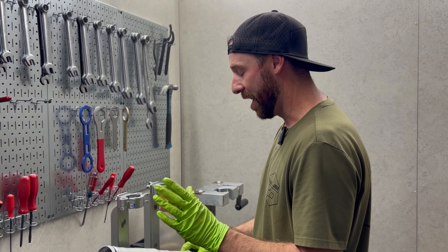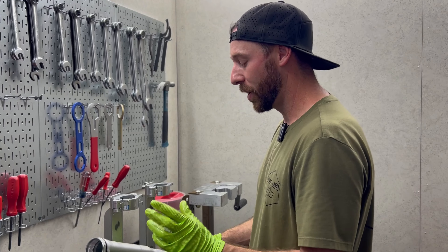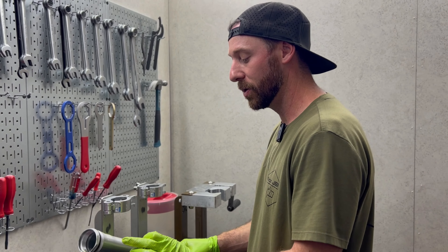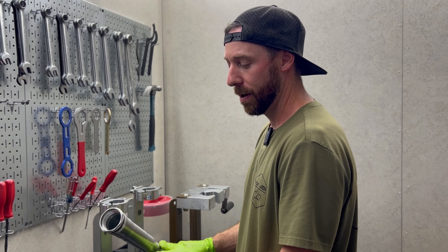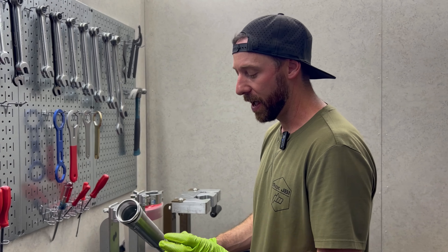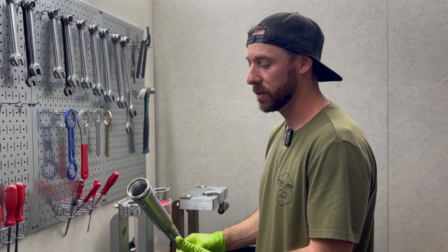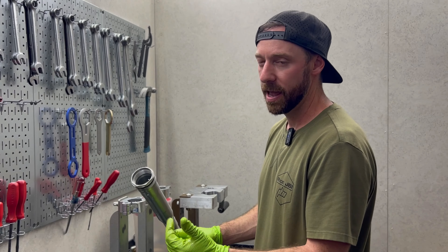We're going to keep taking this apart and installing our JBI spec Honda Pro 4 kit. I'm excited because people that get to try our JBI spec setup on this new 2025 Honda in comparison to what's in here now — I'm confident they'll be very pleasantly surprised with how much potential we can get out of these forks. To be specific, we're going to get these forks to be a lot plusher on small and medium bumps, and have much better hold-up and bottoming for aggressive riding and big impacts.